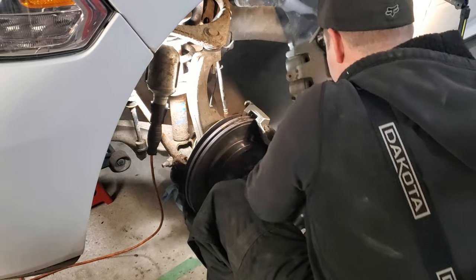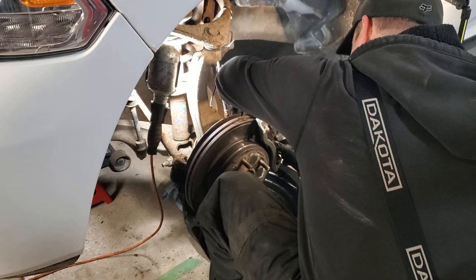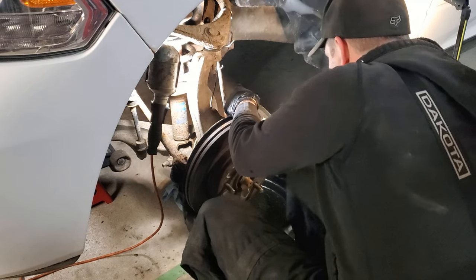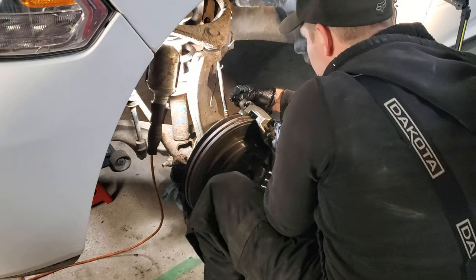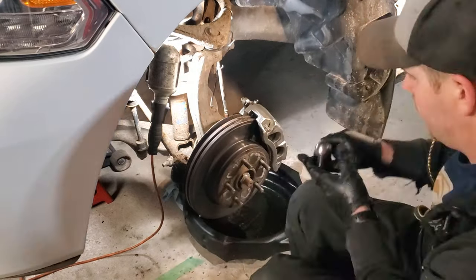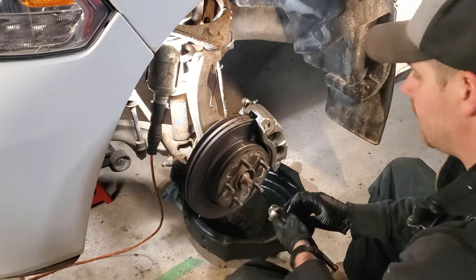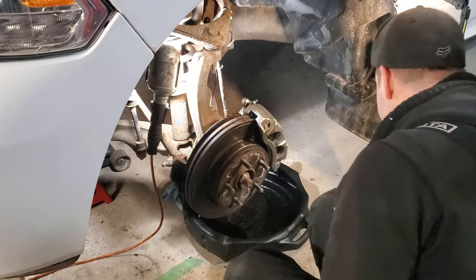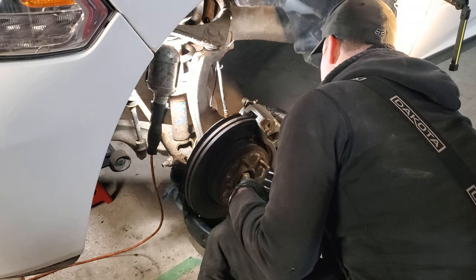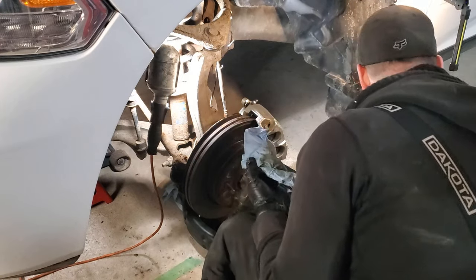Very carefully take our caliper and we'll fit it over our brake pads like so, and having my caliper bolts handy, I'll feed them in by hand. This is just to help me orient the brake line properly. So we still have our crush washer in on the bottom. And I have my other crush washer ready to go in, as well as my banjo bolt.